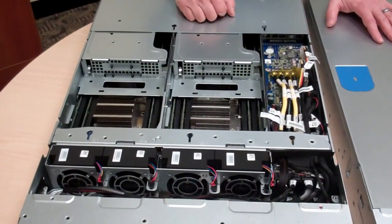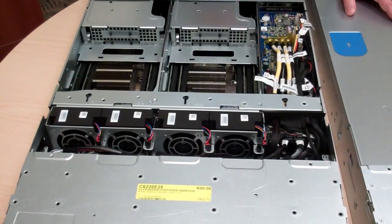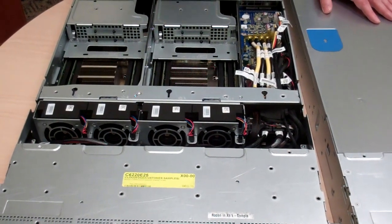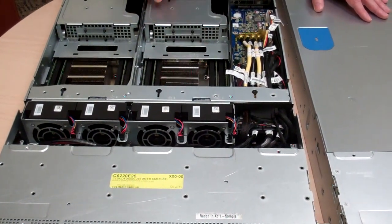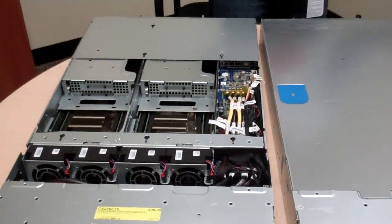The third piece — and one of the larger areas of power savings — is the fans themselves. The fans are now a slightly different size, a slightly different efficiency fan, and they're tuned to a slightly different fan control algorithm. A lot of power is saved in just the fans, tweaked and tuned to exactly the impedance and characteristics of the chassis. Altogether, the power efficiency savings compared to our C6100 chassis have netted us about 100 watts of savings when running at full load. We're really trying to drive home that performance-per-watt story, working on the denominator — the wattage — as much as the performance.